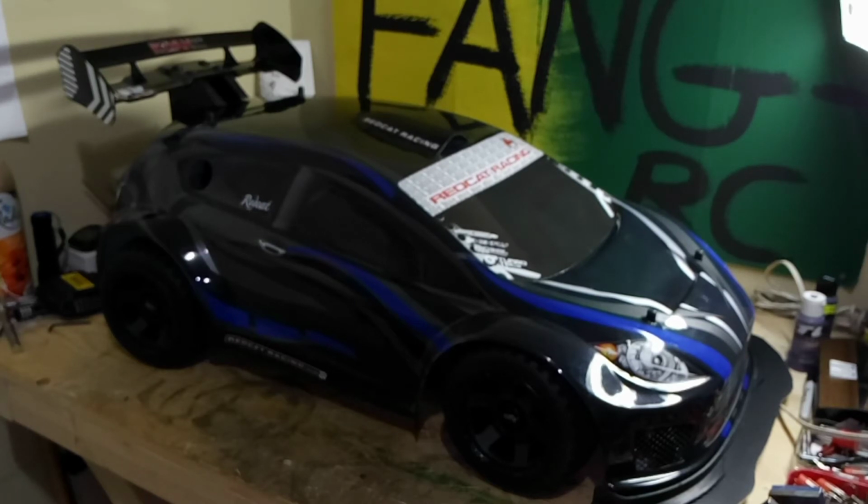As I said, I bought it last year in the summer. I haven't started it yet. Just been working on it, you know, ordering parts, building the parts I can build. Let's see, simple stuff like the brakes in the back, I built that. The air splitter, built that. The spoiler mount, built that. What else? The muffler, I redesigned the muffler from a single to two pipes, and also cut it, took the cone out, resealed it, re-welded it, aluminum weld, and just a ton of stuff to the engine, little things that would make a huge difference in performance and looks. All right.